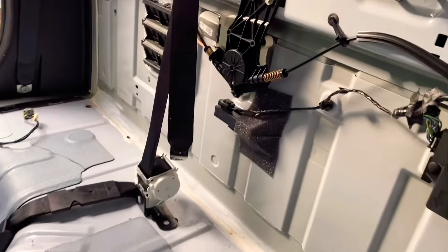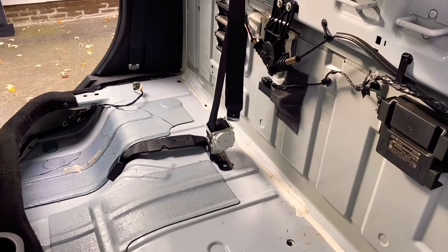I'm not putting the seats back in because I'm going to the track tomorrow — I'll put them in next week. So it's sealed. It wasn't the brake light this time, it was the vents. Thanks for watching — I hope this helps somebody. If your truck smells like a dirty foot, it's most likely a leak in the back: either the third brake light, the vents, or the grommets under the seats. Pull them up and silicone them to prevent future leaks. I am doing a separate video on the third brake light leak-proof fix, and also a 100-octane pull on my truck. Stay tuned — till next time!